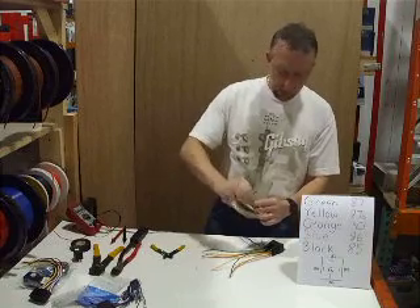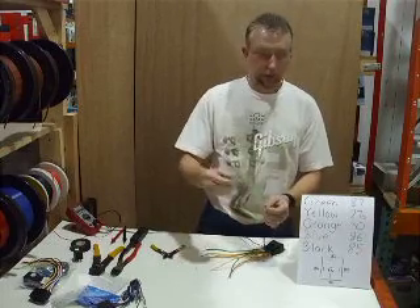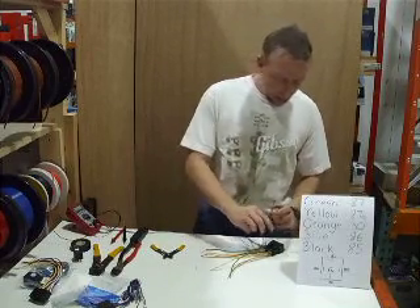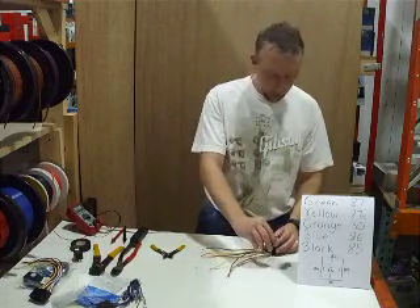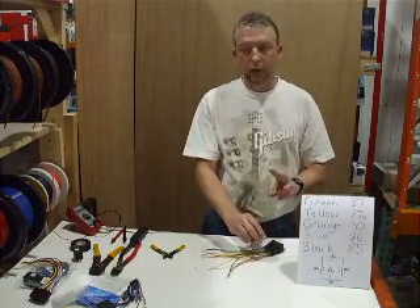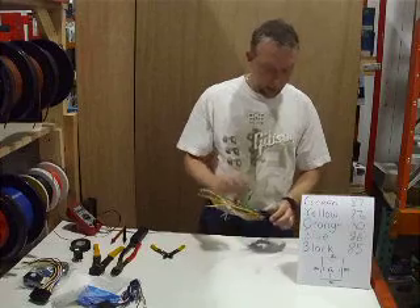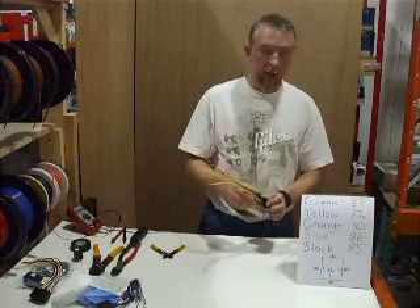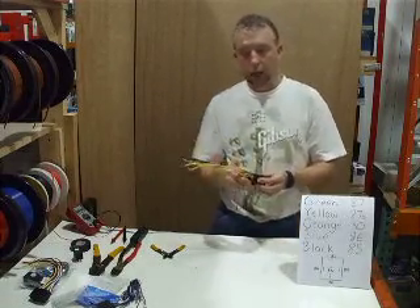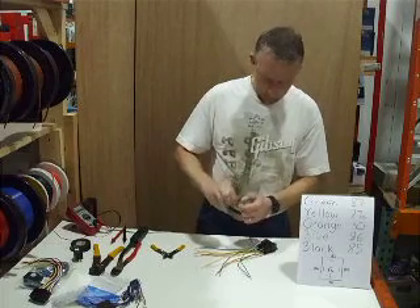Even though in the car — for instance, pretend this is like a GM or a Dodge Chrysler Sebring, they're famous for having these — they use a negative type of system in the one-wire door locks. Even though it only requires the resistor on the unlock wire in the vehicle, I always suggest using two relays instead of using a diode on the lock and then just beefing up with a relay and a resistor on the unlock. The reason being is because once you use a relay, it's automatically going to act as an isolator and it's going to give you a stronger signal on both lock and unlock in one shot — it's guaranteed. When you're done, you're done. You don't have to go back and say it's not working — it's done right the first time. Doing it right the first time is definitely not overrated.